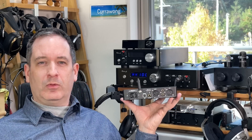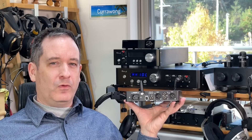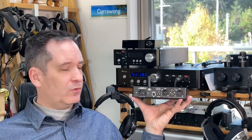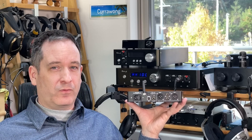Optical — some people will have optical on their motherboards. You may get 24/96 performance out of it, but up to 192k you may need a high-end optical cable. That can be a dicey proposition, as I've found — it may not be so reliable, even if it does provide electrical and noise isolation from your computer's motherboard or whatever source you're using.